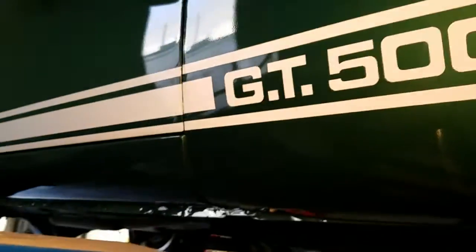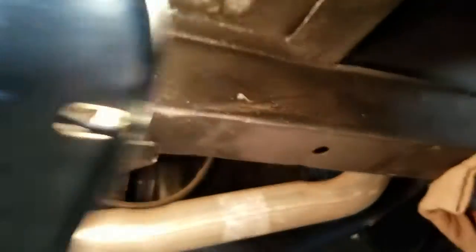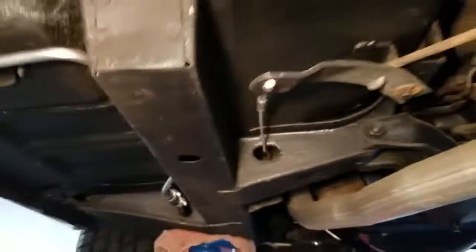Did a digital paint meter and magnets all the way down. Let's stay underneath — focus. There's been a black textured paint applied to the rails, floors, and wheel tubs, so that covers up those OEM spot welds, making it a little more difficult to see if there's been surgery conducted. But my gut feeling is no — it all looks and fits together pretty nicely.